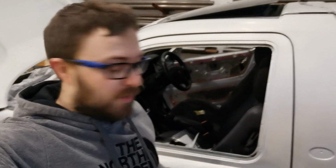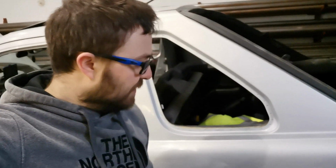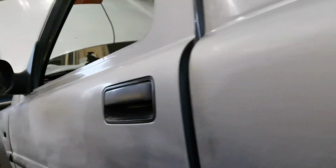Okay, so gone over the whole car with the tack cloths. We had to do a few extra bits of sanding here and there. Just weren't very happy with the effect from a few of those sanding pads that we used. It's just a bit too fine. So we've gone back over a few bits and pieces, and we've gone over the tack cloth, and this is the effect you're looking for, kind of like a dusty hue to it. You take most of that shine out.